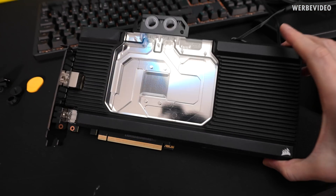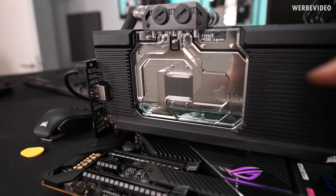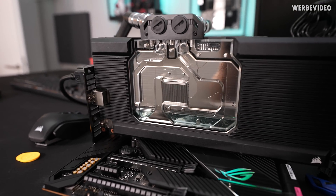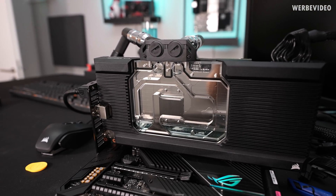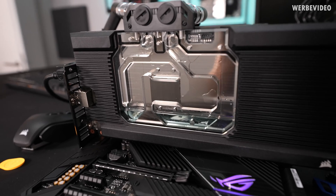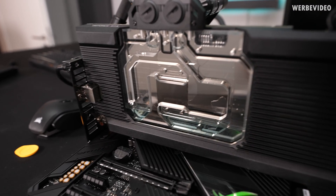Let's see what kind of temperatures we can get. The card is attached to the water cooling loop. By the way, these Corsair blocks don't have a dedicated flow direction because they don't have a central axis point structure — it just flows right through. So it doesn't matter if you have your intake or outtake on the left or right. That's a positive aspect in that you don't have to care about flow direction when mounting the card in your loop, but you might lose half a degree or maybe a degree — though it's not massive because there's still plenty of surface area inside.